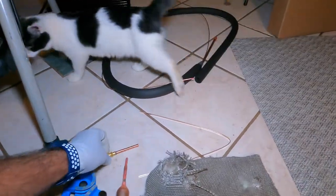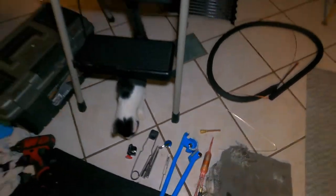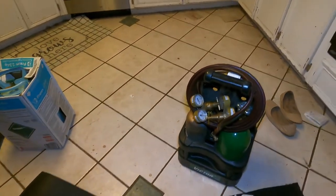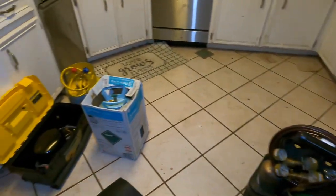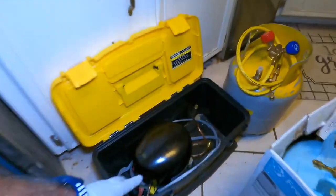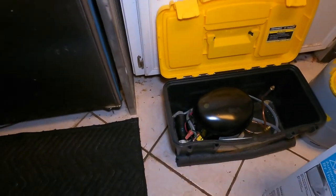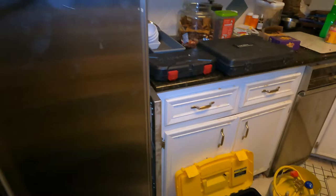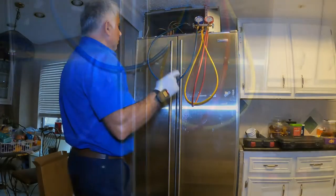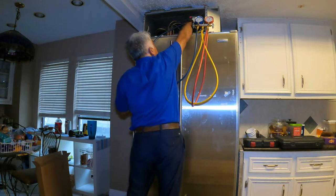These are the tools for a regular sealed system repair. I use an acetylene torch — higher temperature is best; propane gets too much heat and damages the fridge and other parts. For a vacuum pump, I use a regular compressor. There's no need to pay a thousand dollars for a yellow jacket vacuum pump. And there's no need to vacuum it since it's already under vacuum — I'll just close it.